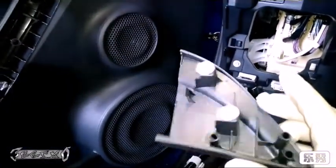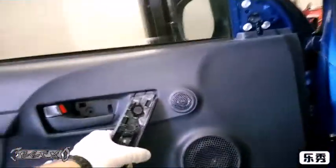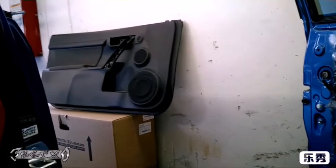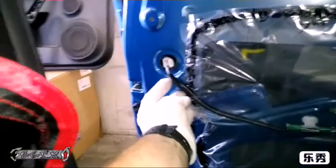Pull this piece off first - it just wiggles off, or use your plastic pry bar to pop it off. Make sure you don't lose those two little white clips. Now pull the door panel off - I'll have to use two hands. The handle and lock will kind of pop out on their own. Pull the panel off; it'll have wires attached so don't rip it too hard. There's a connector you need to disconnect - push the button on the side and pull it out. It can be hard to pull out. Put the panel somewhere safe - don't set it on the ground where it can get stepped on.